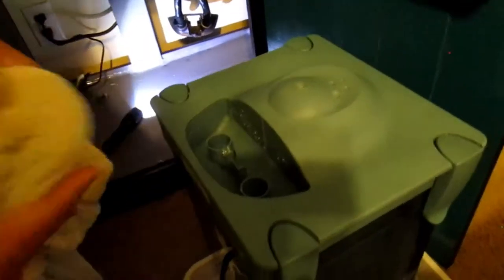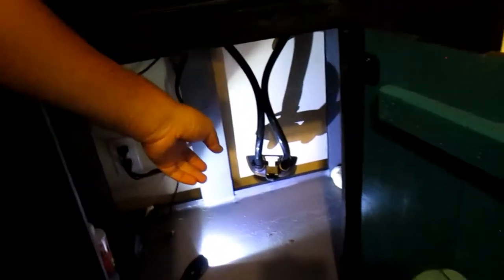And if you lubricate it with silicone grease, it'll last longer. Your problem has nothing to do with the lid when your canister is leaking water out the plug. It's that valve there. You just replace that valve for like $16 and you're good. Or try lubing the O-rings and see if that can fix it.